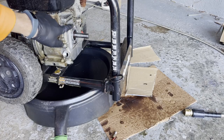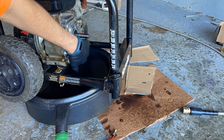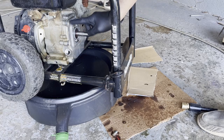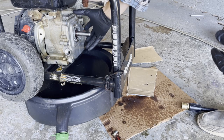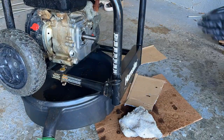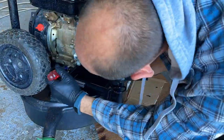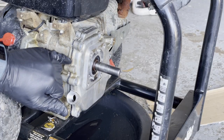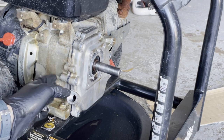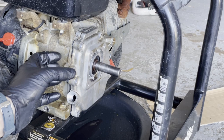Now what I'm going to do is remove the bolts on the side. We removed all these bolts and now I'm going to try and pull this face of the engine off. I don't know that I'll be able to salvage this gasket — a lot of times it'll stick to one half and then the other half of the engine, and it'll actually tear in two pieces.